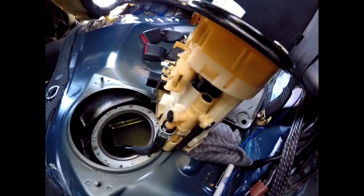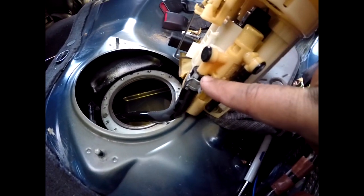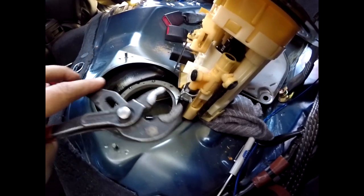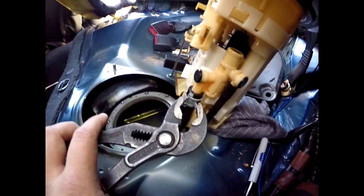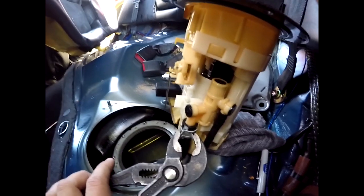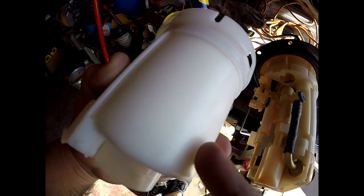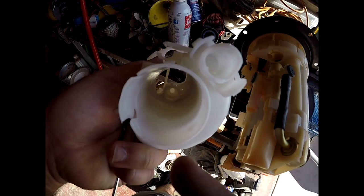Now that we've got the line removed, let's start removing the eight millimeter screws that keep the cap on. I've taken out the fuel pump unit - the whole assembly. There's one line still attached, a rubber hose inside the fuel tank, and of course he delivered it to me with a full tank of gas. We're going to remove this clip and hose, take it to the bench, and start taking it apart. The new part is on the left here - the filter is actually located in this portion right here and it looks like a little sock filter.